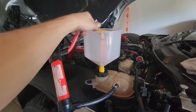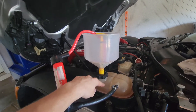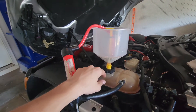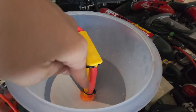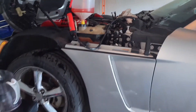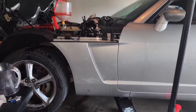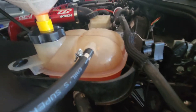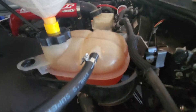You're gonna have a huge vacuum in here. When you go to relieve that vacuum, you just unplug this and it's gonna drain all that coolant back in, so it's refilling this vacuum with only coolant. As you're pumping the air out of the system, it's just gonna dump into that tube and go to atmosphere. All of this, as always, was done on an incline — I've got this thing probably a foot and a couple inches in the air.